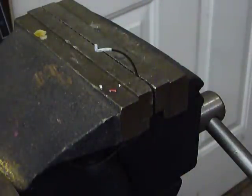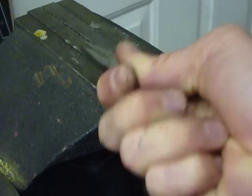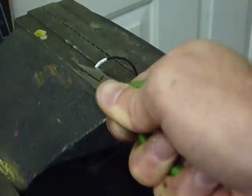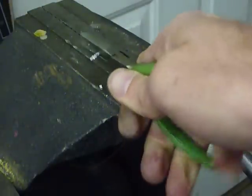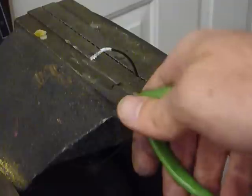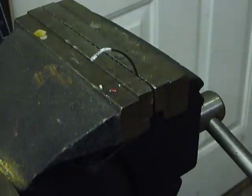In white I have the improved part — it's been properly stress relieved. And what you'll see is this part will take a lot more stress and strain, and in fact will not break until it bends a significant amount more. That's how we get three or four times as many shifts out of a transmission with one of these springs in it, than with the factory part.